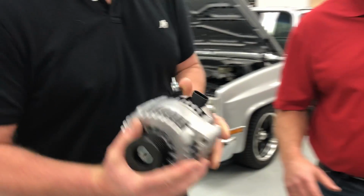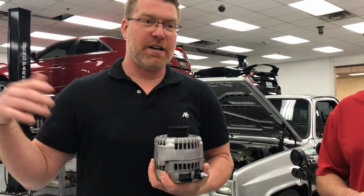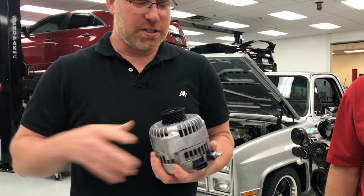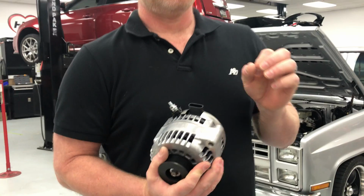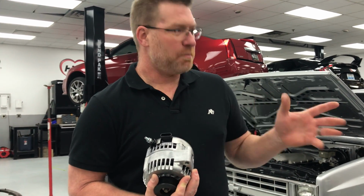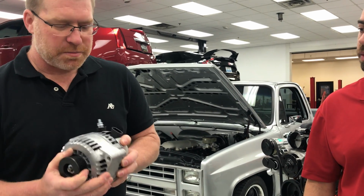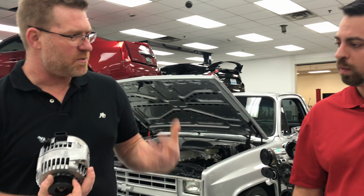That's what I hear. So yes, all of our accessory drives right now are on the shelf, I believe, in the black and the polish. So that's where these come into play. But this is your premium alternator, and it's actually high RPM capable. Again, these accessories were not meant to spin at the speeds that we're pushing them to. The OE accessories weren't. Right. Yes. But this is a Holley piece, and it is high RPM tolerant, and it'll fit right into these high performance vehicles that we have.